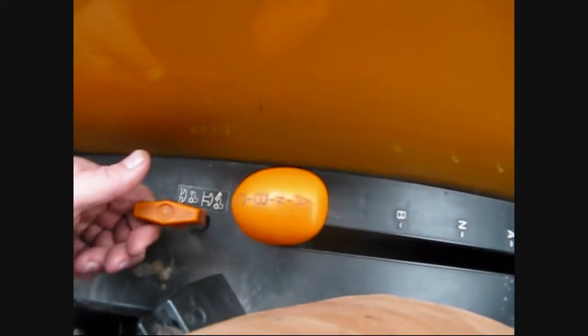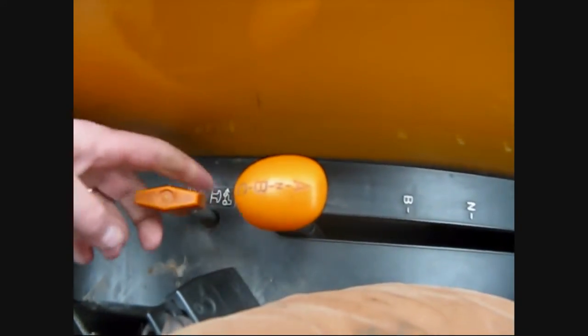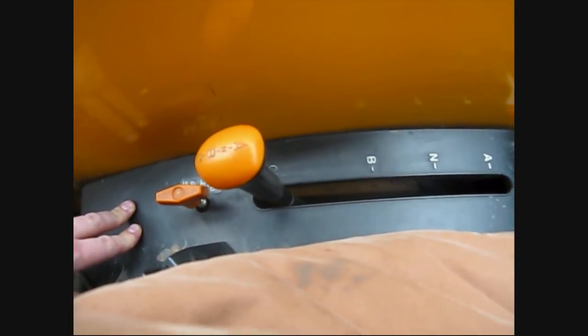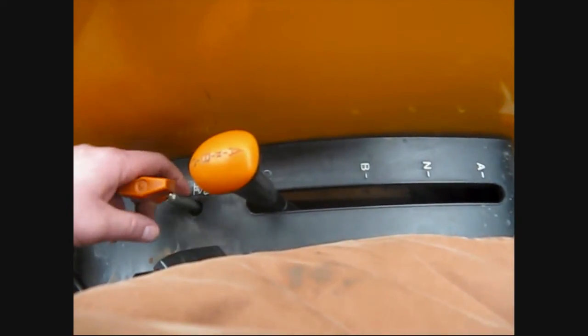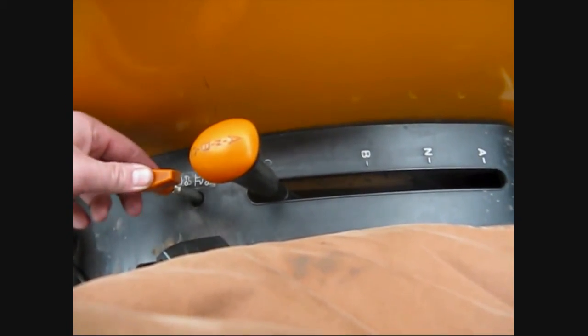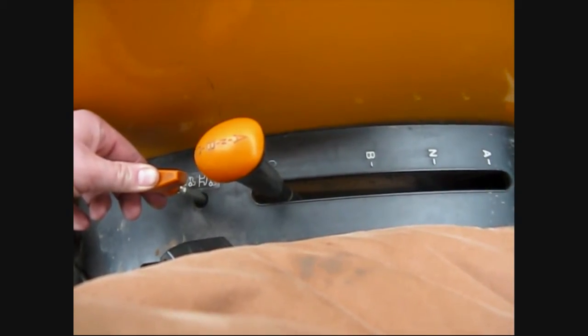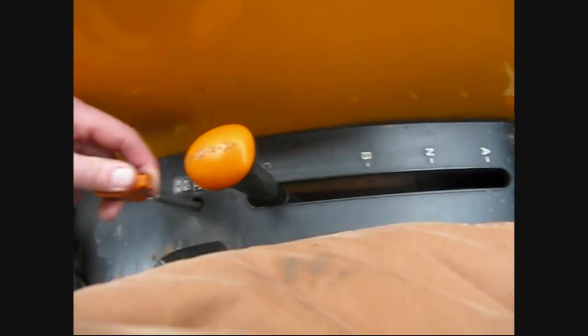This is your four-wheel drive. I'd normally pull this up and that locks in the four-wheel drive so all wheels turn. One thing to note: if you have it engaged and you're on pavement, it's hard on it. To disengage it, you have to stop and then back up — there are certain spots where it releases. Right now it's releasing and engaging right in that spot.